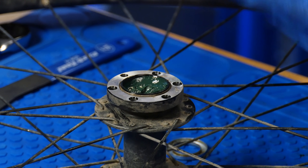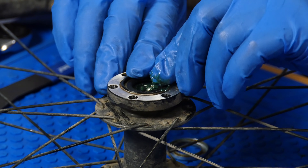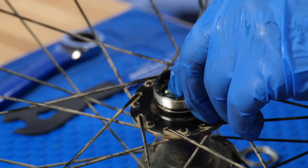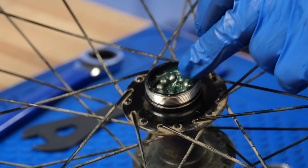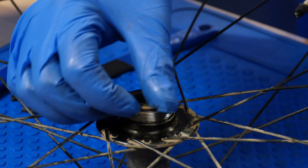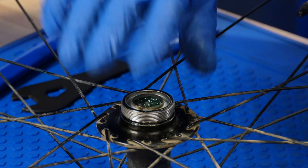More on the outside — that seats them in and glues them. We're essentially gluing those things down for now. And on this one, we're going to put the rubber seal on this side, nice and easy. Now we're going to go to this side — a nice bed of grease and more new bearings. With the correct amount, one more will not go in without shoving up another, so basically it's as many as will lay flat. The labyrinth is up — we're going to try and push that in gently. There we go. Gently around the edge, because that'll make it flush. We don't want to go in the middle and dent things.